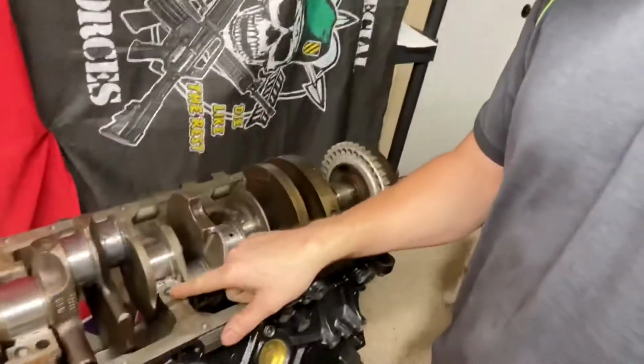When you go to 59 foot-pounds, it might not be fully torqued down if you have stuff in those bolt holes, because of the extra oil, or if you're spraying WD-40 down in there, or you're drenching your bolts in engine oil or something like that. That engine oil is going to be compressing inside that screw hole, and that's what's going to be pushing up against it, and the main bearing cap may not be completely seated with that torque specification. So the bolt might be under 59 foot-pounds of torque, but the main cap would not be if that was the case, right? Okay, moving on.